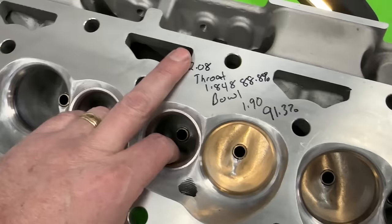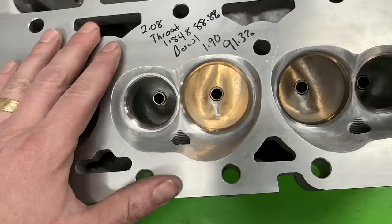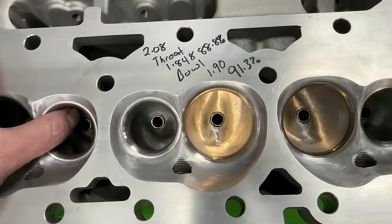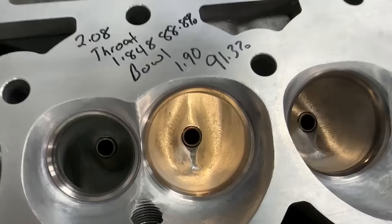I know it's really tempting - I've shown what not to do, taking it out larger. You never do that. It's a bad idea. You need the angles to make the air turn into the chamber, and it also creates a venturi effect. Can you go bigger than 90%? Absolutely. On my own porting, I might do a 50-degree valve job and go like 92.3% - that's usually the biggest I'll ever go. But it's usually because I'm running a steeper valve angle and it depends on the architecture of the head. Staying at 90% is the guideline. This head stayed at 88.8% - it looks good.